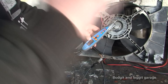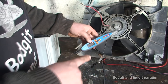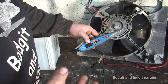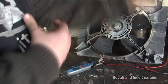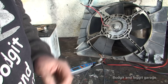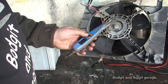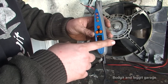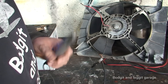With duty cycles, imagine testing an ABS sensor that should read 50% — on 50% of the time, off 50%. If you monitor it for a few seconds and it jumps to 80%, that means more than likely you've got a broken tooth on your CV joint, because it's measuring 50-50-50 and hits the broken tooth with a bigger gap. That tells you it's not the ABS sensor that's gone — it's the ABS ring tooth. Then you know to start stripping the CV joint rather than buying a new 200 quid sensor. That's the beauty of testing duty cycles.